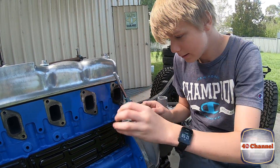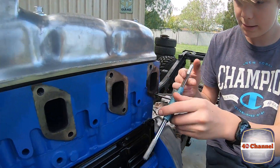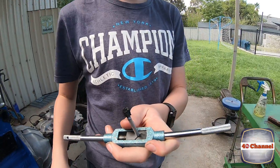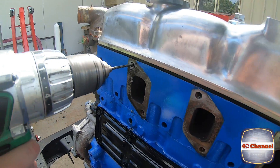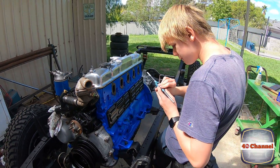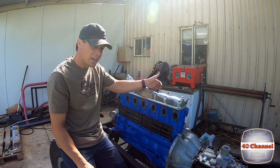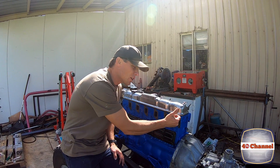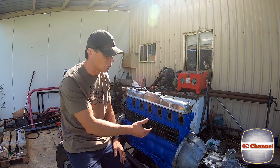Just put a little bit of pressure on it, unscrew it, and let it bite into the stud — coming out! Another one out, one to go. Try to keep it as straight as you can. That's it — got it! Good job Jack, we rescued all three of them without doing any major damage. If this was the intake manifold side, it's really important that you tape up the hole — you don't want any swarf or any crap getting inside the intake, that'd be a bad thing. Exhaust side it's not as critical.